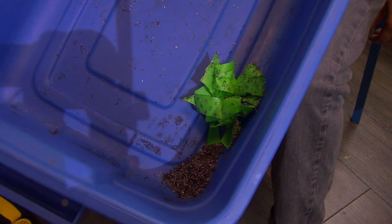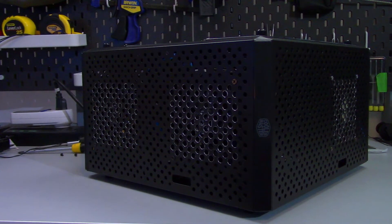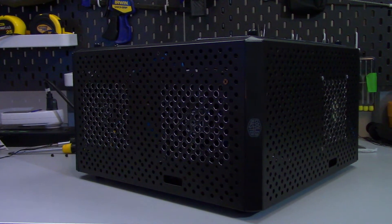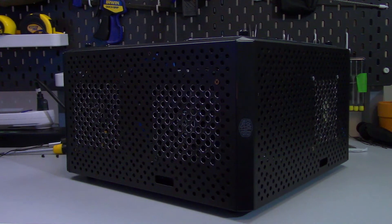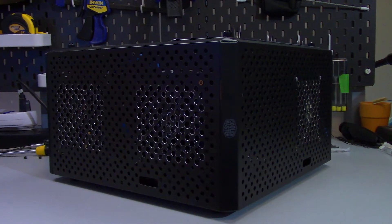It is the next day, and I did actually manage to build the case testing system in the Q300L after a whole lot of filing, sanding, and cleaning. It took a long time to get the case clean enough to where I felt comfortable building a system in it — there was a whole lot of little metal shards everywhere. By doing all of this, I did actually manage to increase the size of the holes by 60 to 70%. I did only drill where I was going to locate the fans, mainly to save time, but it is possible to do a strip down the front and along the top of the case. If you do it that way, just make sure you leave the line of holes meant to fasten the fans to the case alone, because if you don't, you won't actually be able to install the fans.